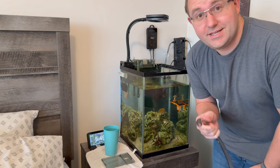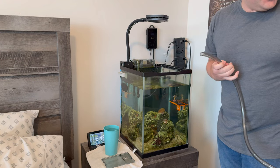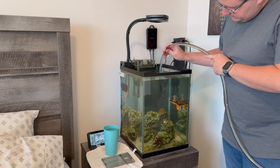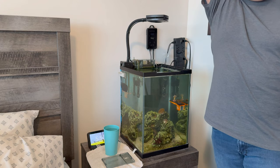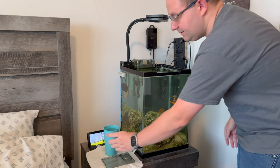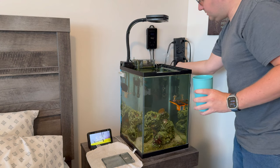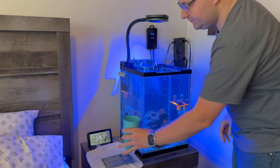This next part is a bit of a two-person step, so I have some help from my lovely girlfriend. Ready to plug that in? The pump starts up right as soon as we plug in — go for it. From here we just lift this up so water doesn't spill all over the carpet, back down it goes. Now all there's left to do is turn the system back on. I have this cup with water to prime the filter — give this power on, start everything back up, and beautiful.